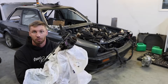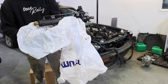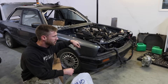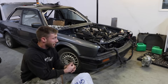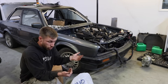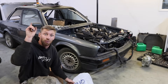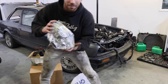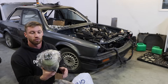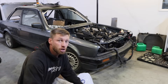Apparently the purple tag is a thing in the BMW world - it's the M Sport version of their steering rack. This has got like a 2-point-something lock-to-lock instead of a 3-point-something. It's a quick steering rack, a lot quicker than the one in there at the minute. With this rack you can reuse the tie rods and track rods, so it's basically plug and play. Since we're going to be doing an electric steering pump setup, I've got an electric steering pump from a Mark 5 Astra. This lets us take the power steering off the engine and run it wherever we want in the car.